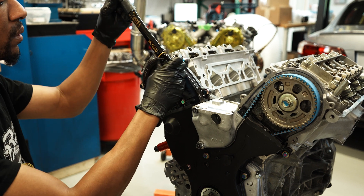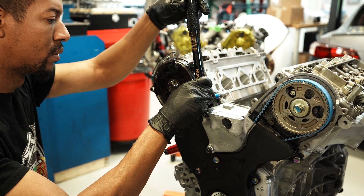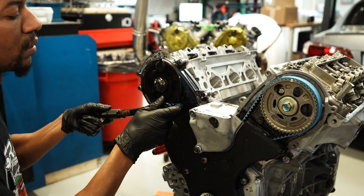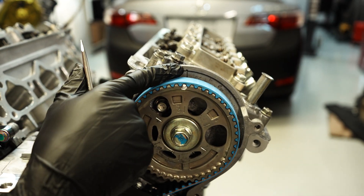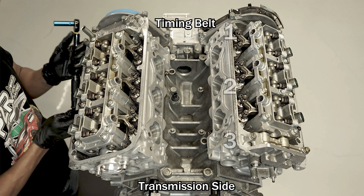I'm going to start by showing you guys our see-through timing covers. Since these are see-through, I'm going to go ahead and get the rear cylinder timing cover installed with our titanium hardware. That looks really nice — we have a neochrome look here. So once your engine's at TDC, you'll notice there's a one on the cam gear and that's going to line up to the cam back end plate.